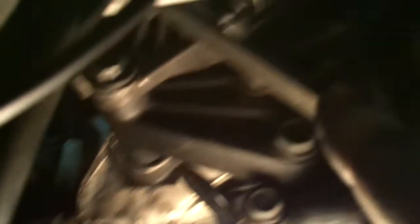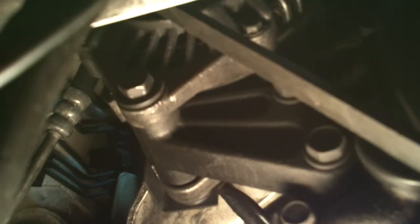Before you can loosen tension on that alternator belt — here's the belt right here. That bolt right there is your alternator pivot bolt. It's a 15-millimeter. Break it loose, back it off just a little bit, and then when you adjust that 13-millimeter nut up there, it will release tension.